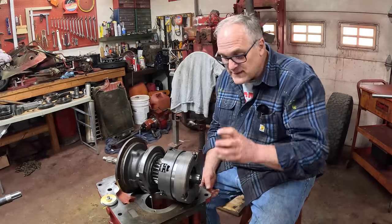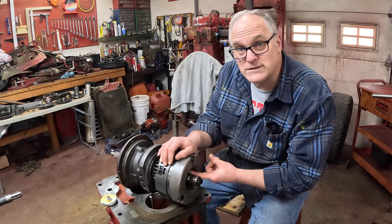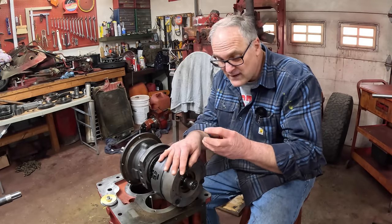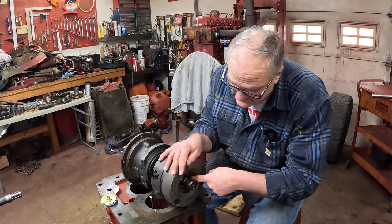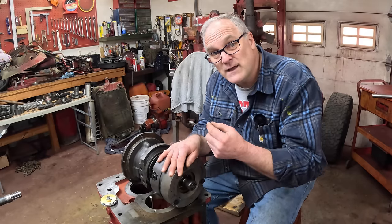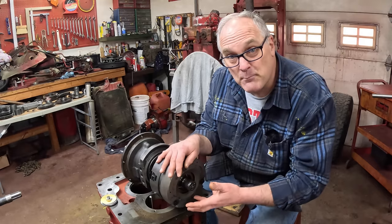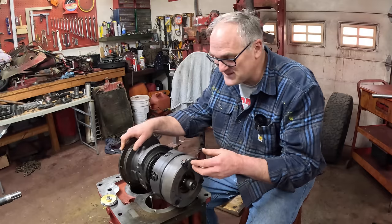The reasoning is this: the old TA has three clutches in the rear, and the quill shaft is where you're measuring end play. You want the quill shaft five to twenty-five thousandths because if the shaft has too much end play, it'll come disengaged from the fourth clutch plate way down inside. So really what they're looking for is not too much end play. As long as I have free rotation and it's not binding, I'm all right. It's interesting what you learn when you start talking to somebody who's done so many of these.